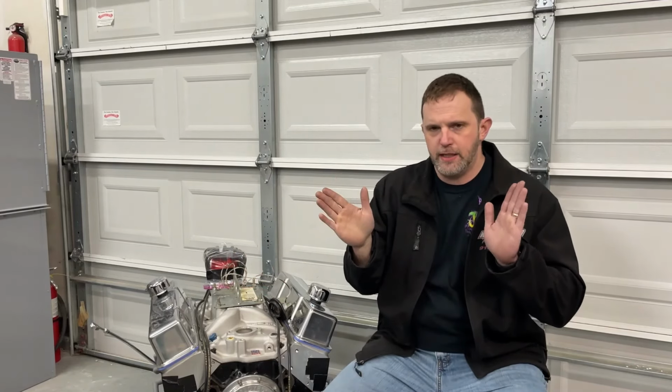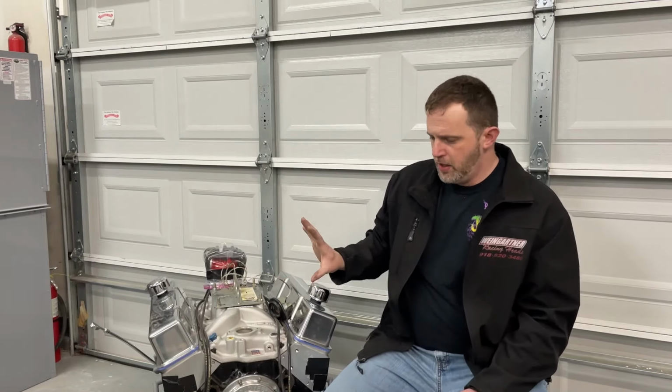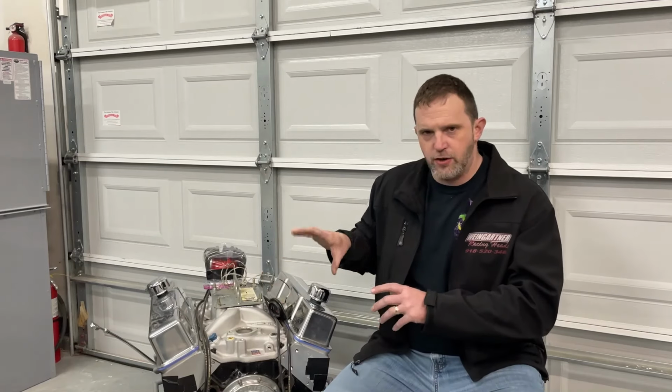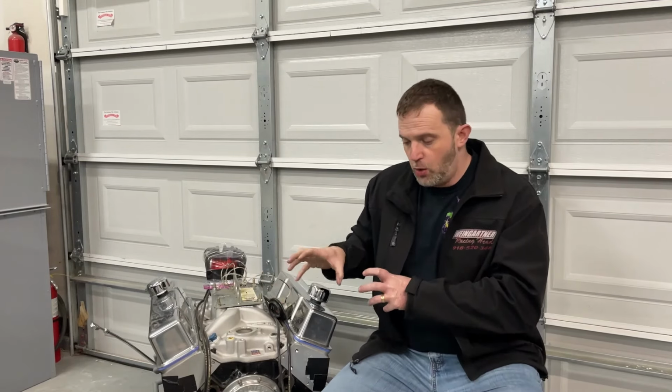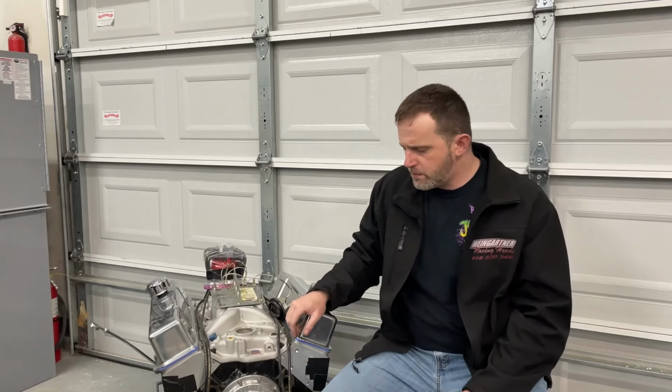And the reason why is you're kind of at the end of the range. And remember at the beginning of my video, he said, I want to keep it between 90 and 20. And usually when they roll in the throttle, the servo value is actually really high, because if this engine's already spinning, it takes more to slow it down to speed, and it doesn't take as much to let it accelerate. So the servo value is usually high at the beginning, and then it backs off so that the engine can climb in RPM. Anyway, from the beginning of the run, it was like 90-something percent. At the end, it was getting down to 20 or below.